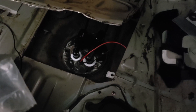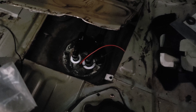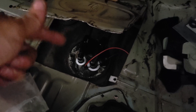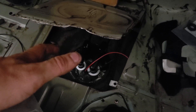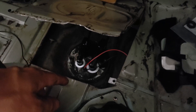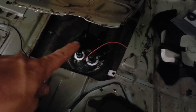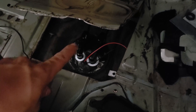As I was wrapping up this video and moving along, one thing I forgot — the fuel pump hanger. Fuel pump is pretty much bolted down, I'm missing a couple bolts. But I didn't want anyone thinking this is the final setup. I'm also missing a vent. The tank is going to be pulling fuel and it needs air to replace where the fuel was, or else you get vapor lock — the tank could suck itself in. You need a vent. The stock system has one and I said I was going to upgrade it and forgot. So I'll have to do that in the future, but for just getting the car started this will get me by.